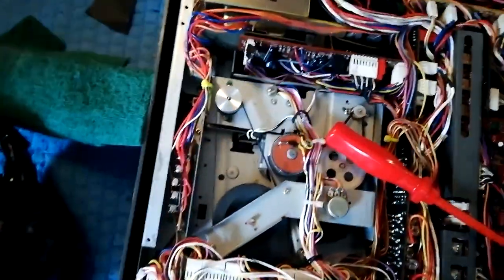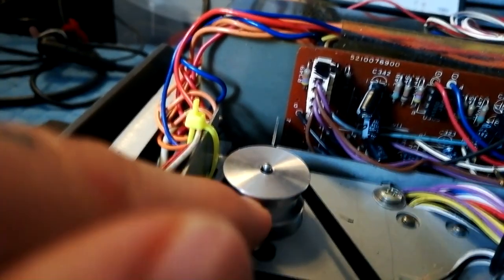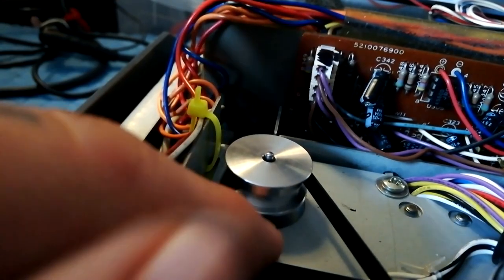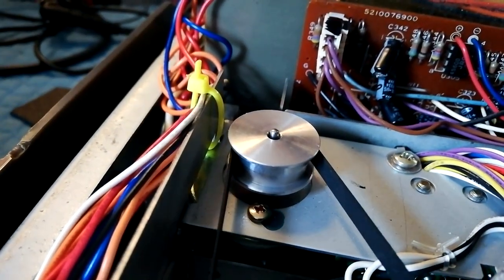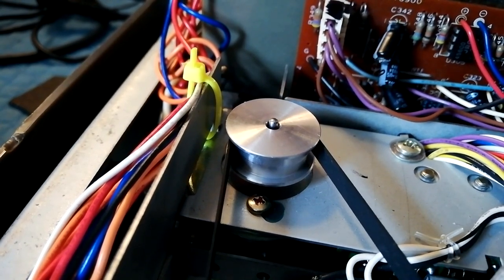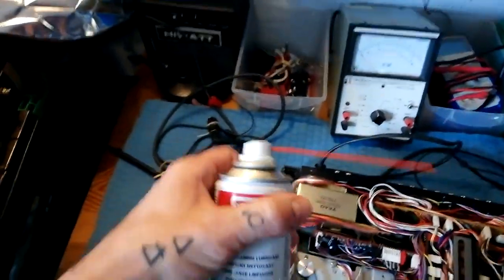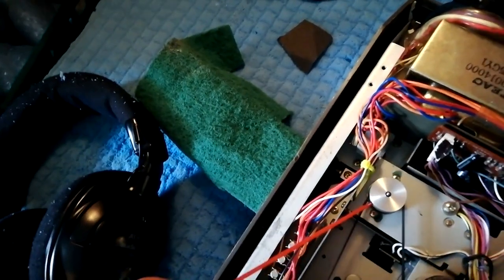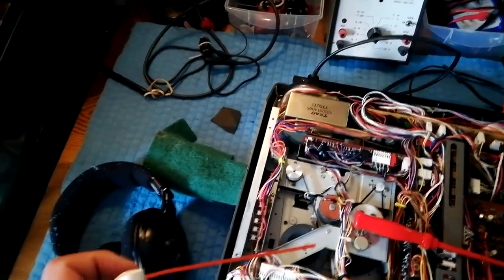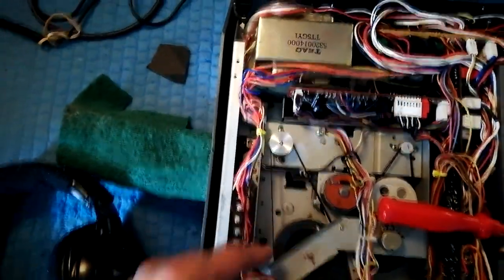Another thing I'm not going to demonstrate directly, because I've actually already done it with this, is you can put a little bit of oil inside the motor. You can see the recess where the pin underneath the pulley goes down into the motor — there are brushes caused to move through electromagnetism around a magnetic core in there, and you can get a little bit of friction in there. You can use WD-40 or something, but I've used sewing machine motor oil. If you get oil with a needle-tip applicator, you can get that needle in there — just a little bit, not too much. Leave it a while, then turn the machine on with a tape in so it starts to spin. That can mitigate physical noise and vibrations a little bit.